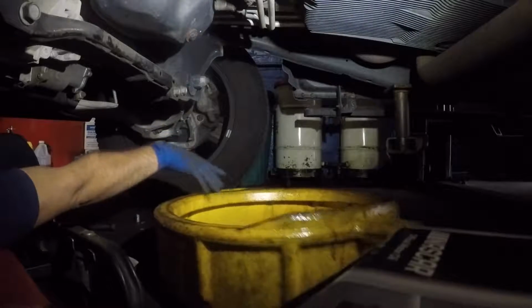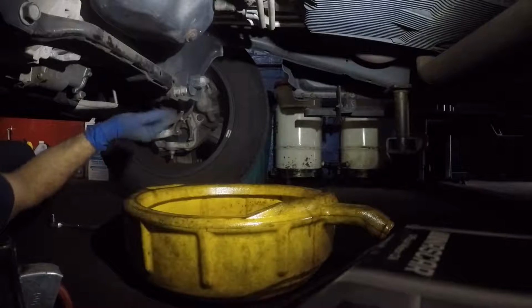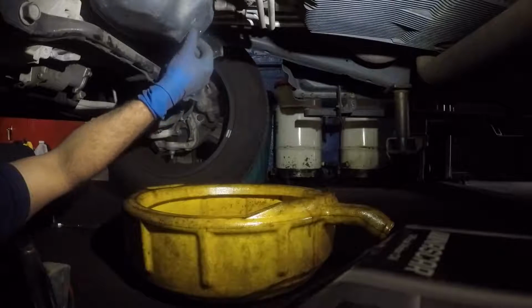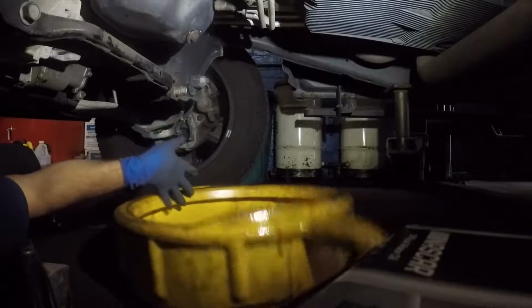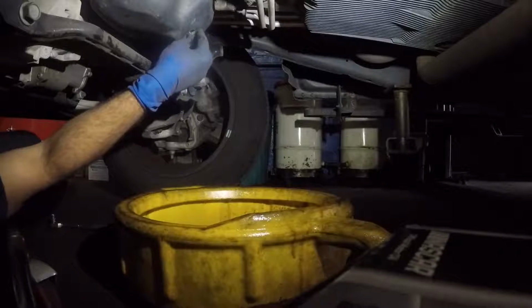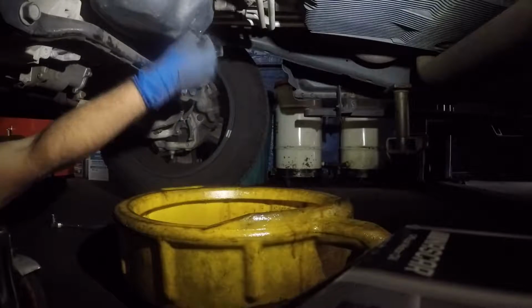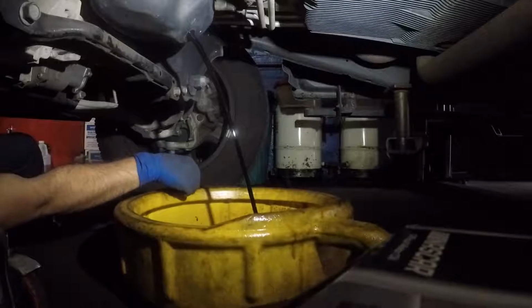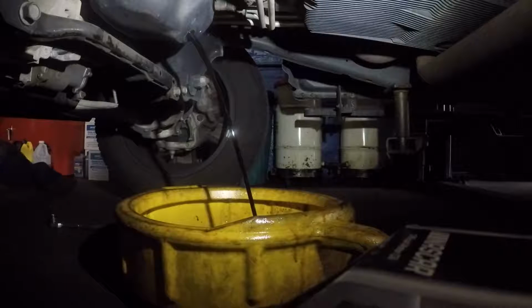This truck is super cold and it's not so hot in there. It's not a hot season no more, so the oil is gonna be very thick. And what you're gonna do is open that drain plug and the oil is gonna shoot out. And you give it a good 10 minutes so it can finish draining. There you go, guys. So I'm gonna leave that there. I'm gonna go clean this drain plug and I'll be right back.